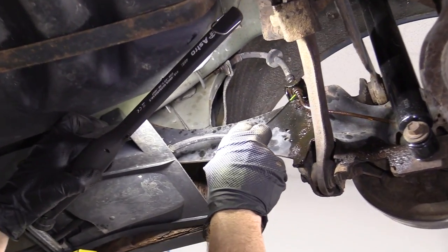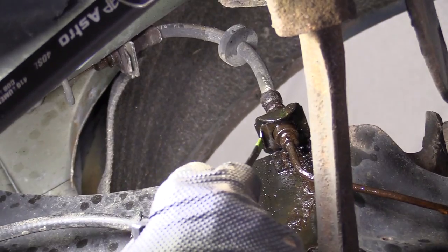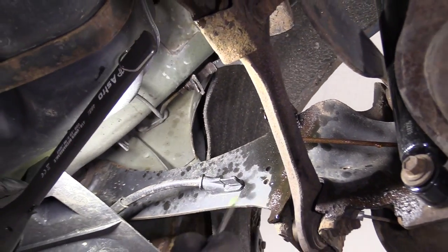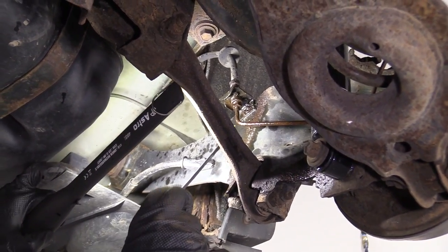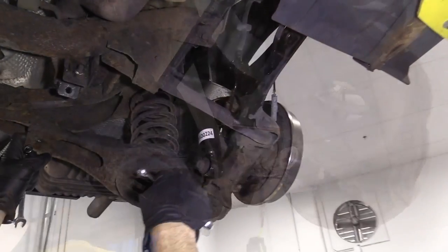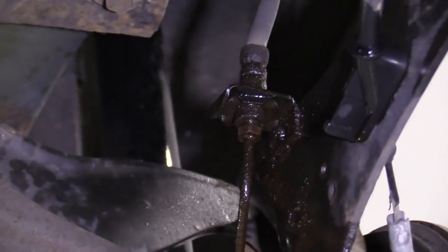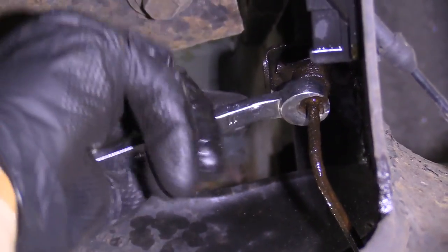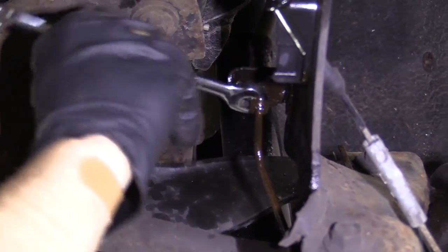What I'm going to do is loosen this line right here, remove it from this bracket, and take out this clip so the flex hose can get up and away and not be holding onto this arm anymore. Once it's down on the ground, we'll make a decision on whether we're going to replace this brake line or try to reuse it. I sprayed it all down ahead of time, all the areas that I was going to be taking apart. I'm going to use an 11 millimeter flare end wrench — it covers the majority of the sides of the fitting so you get extra grip. Then once it's loose, you can use an open end.